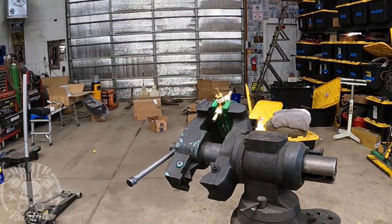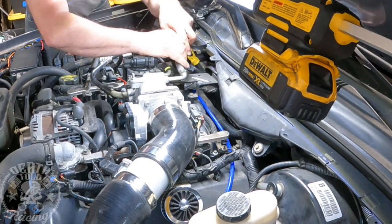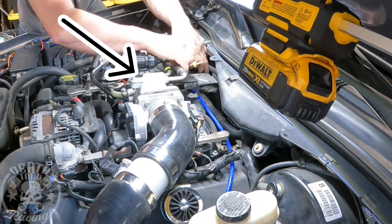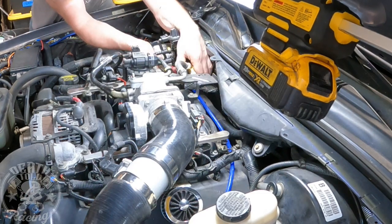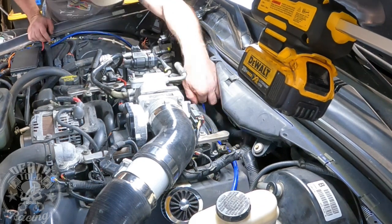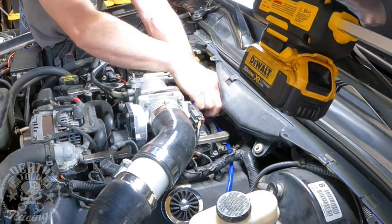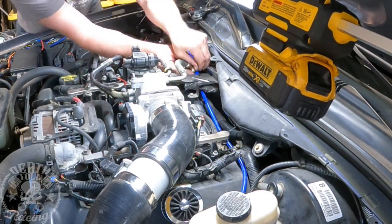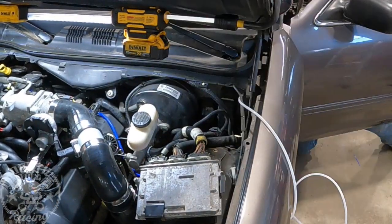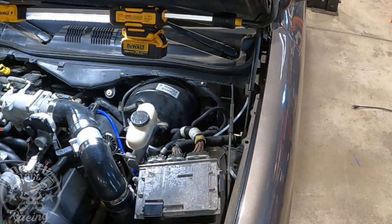This is a T. I found where I was going to access manifold pressure. At first I was thinking about taking that entire intake elbow off and drilling and tapping it. Then I realized I'll just tee the line that goes down to the brake booster, which will work on this one because the one-way valve on the brake booster is at the booster itself — which is fairly common, but probably not always the scenario.